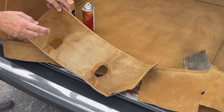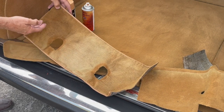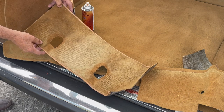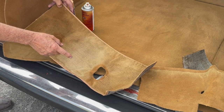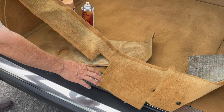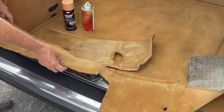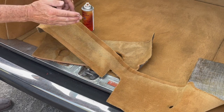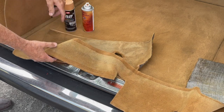I'm going to talk about carpets first, because you have to deal with these a little bit differently than you do with either the vinyl or the leather upholstery on the seats. You can see here's the original color that was hidden by that seatbelt arm cover, and then look where the hump is right behind the front seats — that's what's exposed to UV. It's the light that really gets to the coloring along the side of the door panels. You can see the original color down in here, and then up here it turns really light, and eventually, particularly on the seats, it'll turn a pinkish color. So I use a different product when dealing with carpet than I do with leather or vinyl, and I'm going to demonstrate why I do that now.